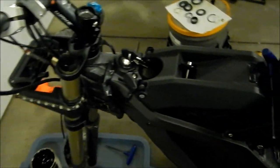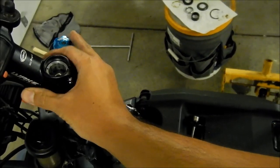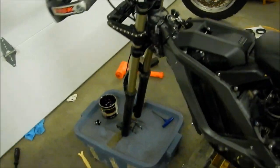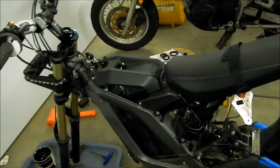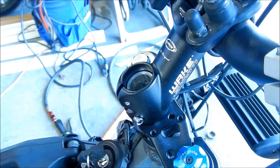We're pretty much done already. Now what we've got to do is tighten the handlebar. What I'm probably going to do is put the wheel back on and then readjust the tension one more time with the wheels on the ground — that way it seats properly. Remember I mentioned I made some marks to make sure we're in the proper position.